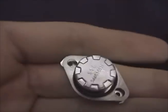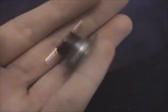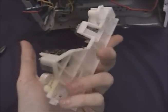The lamp works and it indeed draws 20 watts of power. Here's one of the thermal protection switches — it's a normally closed switch, and I would assume when it hits 105 degrees Celsius it opens up. I probably won't have a use for something like this. I wonder if this microwave design could date back to as early as 1999, because on the switch assembly they have a date table with three years listed: 1999, 2000, and 2001. This was made in 2004, so there's no stamp on any of them, but perhaps at least this switch assembly dates back to 1999.